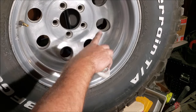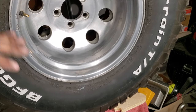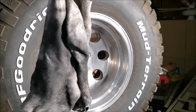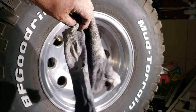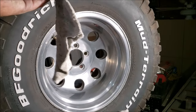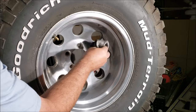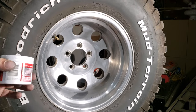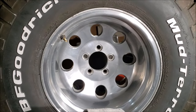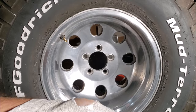Keep repeating that step until all the little sand scratches going in different directions disappear. I'm gonna keep doing that and go finish this wheel up. Once you start getting it more polished out you can start using circular motions in areas — you'll figure out your method fast. Then once you think you've got it, take a clean rag and buff it out one final time. Turn the sock inside out and you've got yourself a polishing glove.